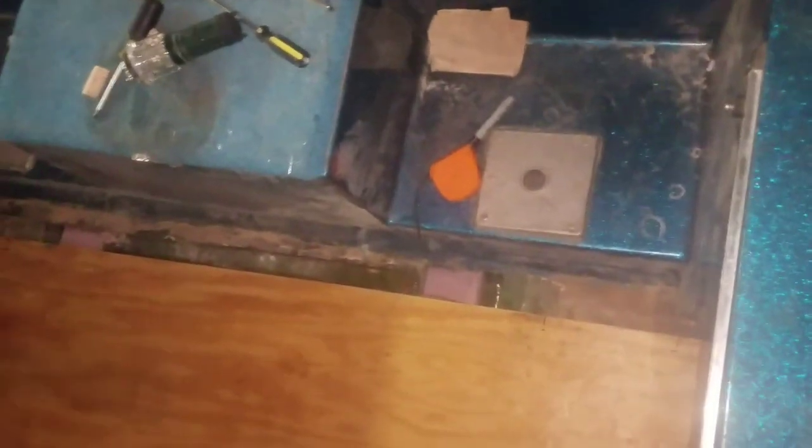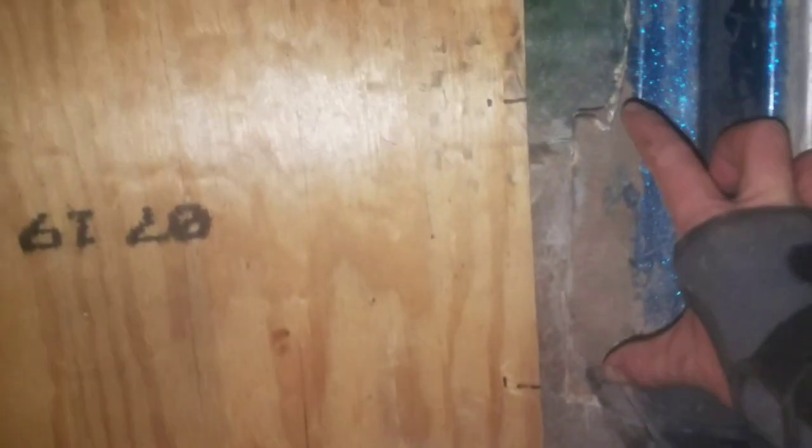The trouble I'm having — there's that jagged edge of the deck where when I took a lot of this off, some of the cuts kind of ripped a little bit of the fiberglass from first prying out the floor, and everything was rotten. So what I'm gonna have to do a little bit on both sides — you can see there's about a one inch mark right here — kind of stuff like that, so that way it'll go around these wider spots and hopefully make this fit close enough I can peanut butter it.